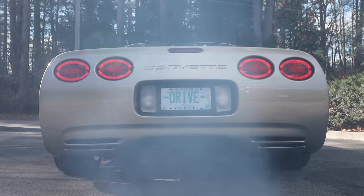For those shorter armed folks, first of all, suck it. And secondly, you're better off taking out all the taillights at the beginning. I ended up having to do it anyways at the end to neaten up my plumbing. I ran the vacuum line to the furthest muffler away, plugged it into the nipple on the muffler, making sure to keep it as far away from the hot mufflers as possible.